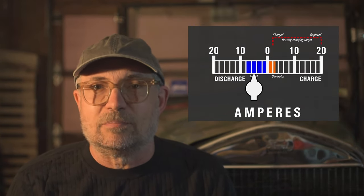Be aware that LED light bulbs will change this balance considerably — they only draw 1 or 2 amps. If I had LED bulbs, I would want to set the cruising charging rate to, say, 3 amps.